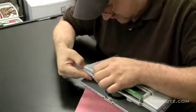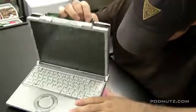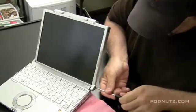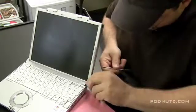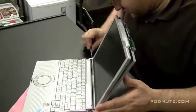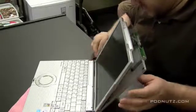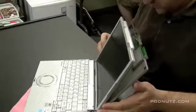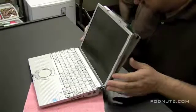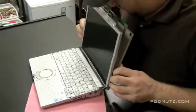See if you can get your finger or something plastic in there around the edge to help you take it off. I fast-forwarded a little bit and you can see it's almost apart, but it feels like we're going to have to force it. Anytime it feels like you have to force something, look for a screw you need to take off — and that screw is actually going to help us get the screen cover off. There are two screws towards the bottom of the screen on the sides, and once they come out it gives us much more access to the screen cover.